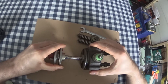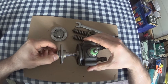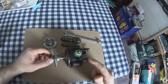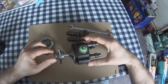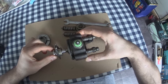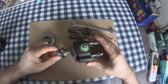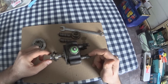Let's break it down into stages. The front groove is aligned with the hole in the body. The fuel flows in, into the plunger, and it can't escape because it's not lined up with the delivery valve yet. The pump rotates, it reaches the point on the camshaft where it starts to push. It pushes the diesel in, creating pressure, and it's turning as well. It lines up with one of the delivery holes in the head, which then lines up with each delivery valve — it's a four-cylinder. And as it's still turning and pushing, it's creating pressure in the injection lines. When the injector gets to opening pressure, it opens.